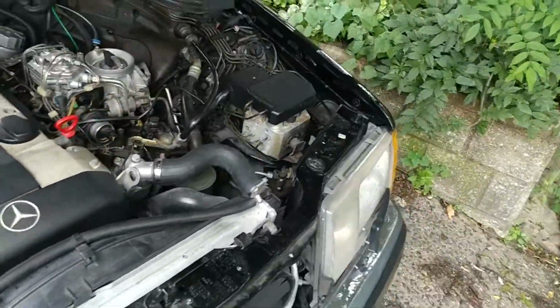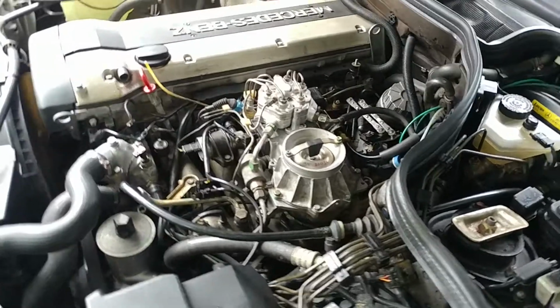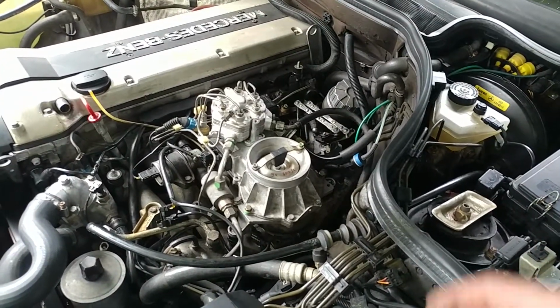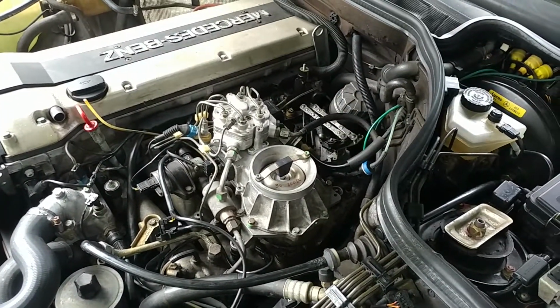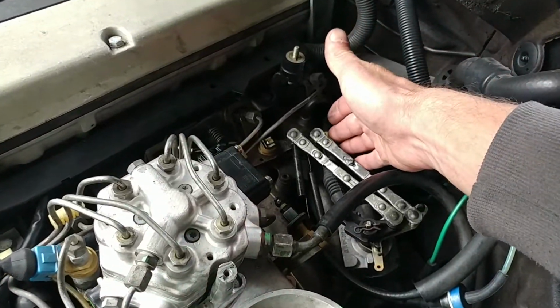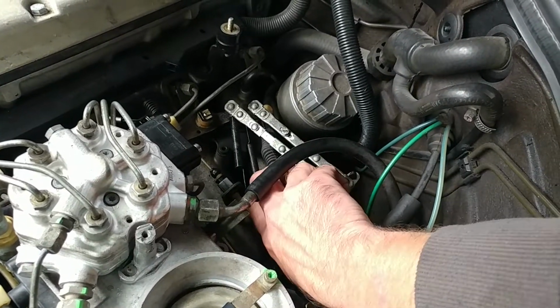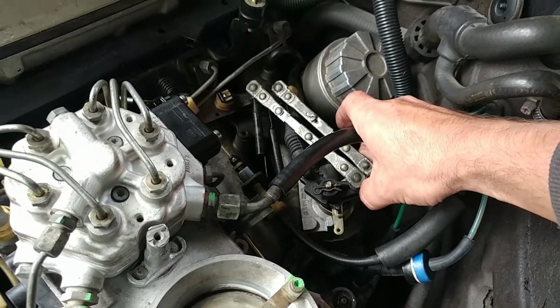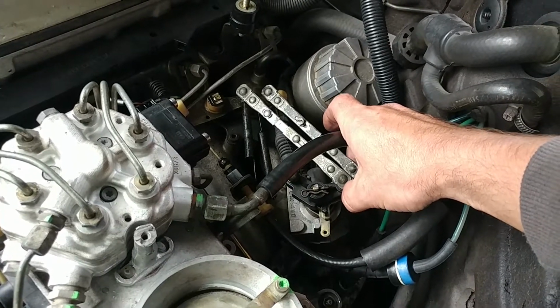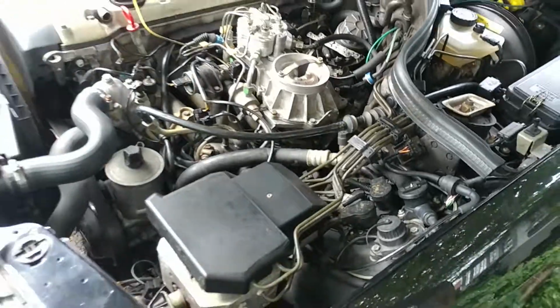Transmission shifts a little weird because it has sort of a delay of upshifting. It does upshift, but at high RPMs, even with working ASR system. I did try to loosen up kick down cable, but it's quite loose already. As you can see, there is play in it, so it's quite loose. So if I loosen it too much, then the kick down will not work.